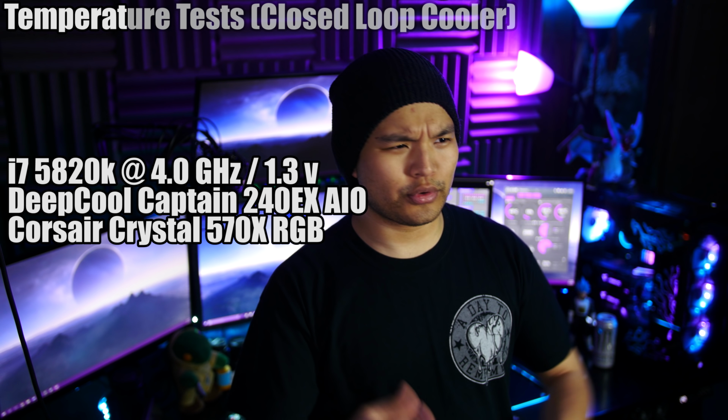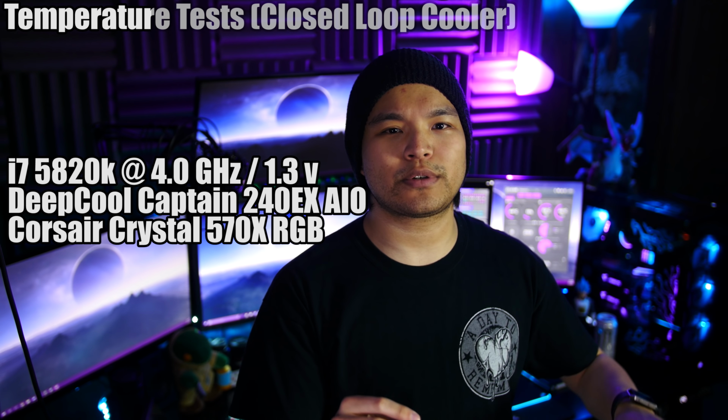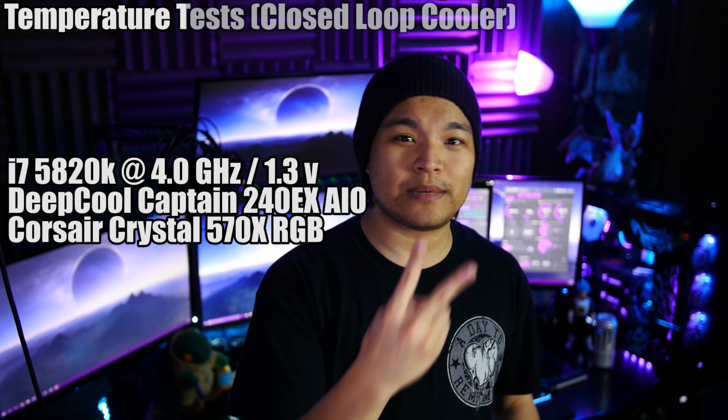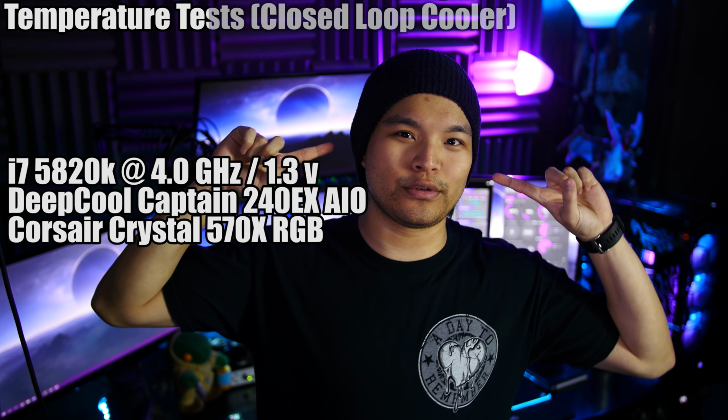The CPU will be brutalized with Prime95 for 2 hours, the first hour to get the liquid to stabilize at a temperature that I can share with confidence and a second hour to collect the average temperatures across all cores. The test will be repeated 2 times afterwards, and an average of all results is what will be massaged into your eyeballs and ear holes.